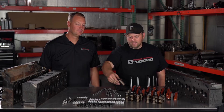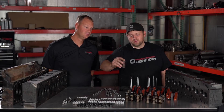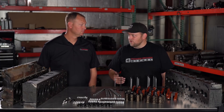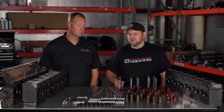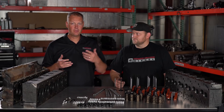When you're doing the Warhead, you need new valve springs — the bigger valves require them. We have these dual valve springs available. We like to raise the seat pressure a little higher for performance. Most street valve springs don't go over 165 pounds on the seat; we start around 175 and take them clear up over 200 on competition cylinder heads like Todd's UCC build, where boost and RPM are really high. You can tailor your valve spring for your application, so when you call in, tell us what you're doing and we'll make sure you get the right spring — not some universal setup that's way higher than you need, which would wipe out a cam lobe.